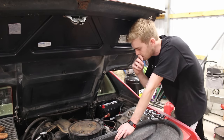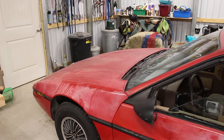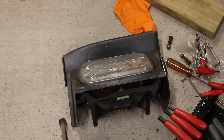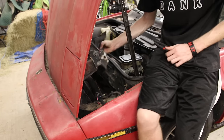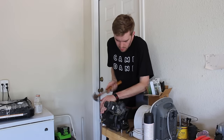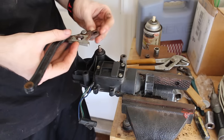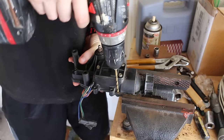There are still a few things I want to do on the engine, but right now I'm going to focus on the headlights because those are more pressing — or really, I just want my pop-up headlights working. The headlight was already taken out from earlier, so all that was left was removing the headlight motor bracket. After that, the motor was separated from the assembly and put in the vise to separate the arm from the shaft of the motor — that was really tight, requiring a hammer and punch. The two halves of the assembly are held by rivets, so those were drilled out.